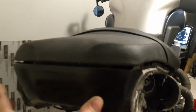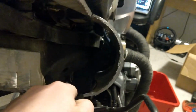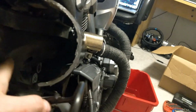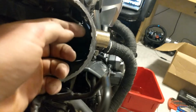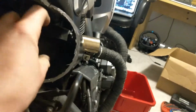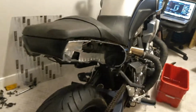I basically got these LED strips that have right signal, left signal, and then the brake light and the running light all in one unit. So what I figure is I just wrap that same LED strip along there. It'll have to go a little bit longer because I think it's a bit longer than that. But whatever, it can go all the way around. And then I wire up the brake light and the running light to the normal stuff. And then instead of running right and left signals, I just do both signals to the same thing, so they just kind of light up on the right side. So that's kind of where I am right now.